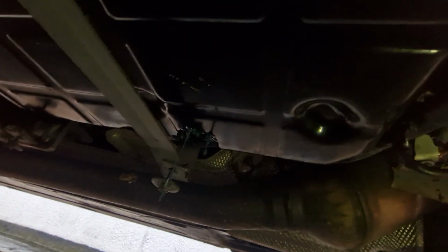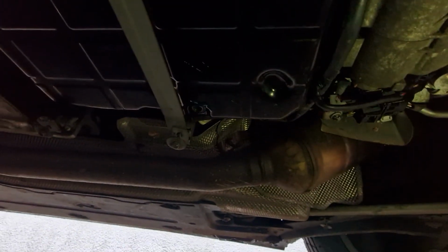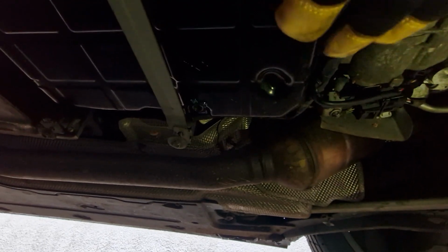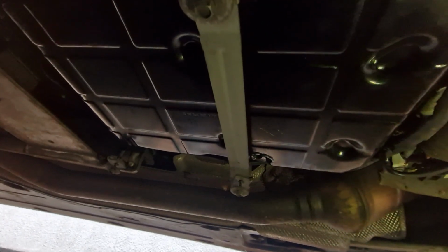As you can see on this one, it's looking nice and clean to be out there, and doing this as well shows us that it's a blue oil type. So I believe there are different colours for these gearboxes, so that's one thing you'll also need to be aware of when you get your service kit, because with doing this procedure and getting the conductor plate out, you will have to change all your oil as well and service your actual gearbox.